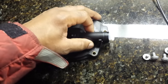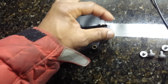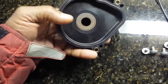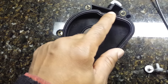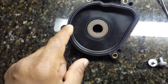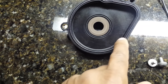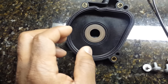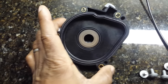It has a hose that goes from the valve itself into the air intake manifold. The reason why you want to change this — there are two reasons. This rubber gasket over time gets brittle and it will crack, and then you'll have oil leaks around this. The oil leak will then drip down onto your catalytic converter and the exhaust.